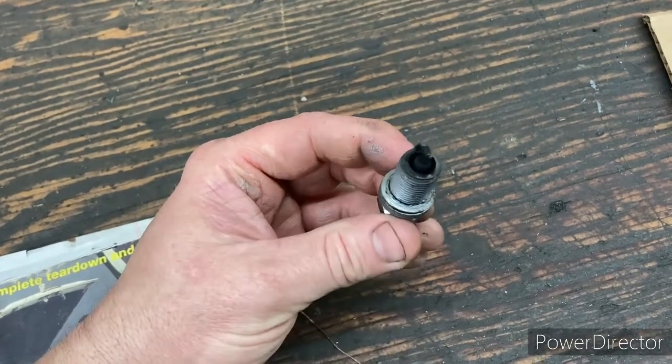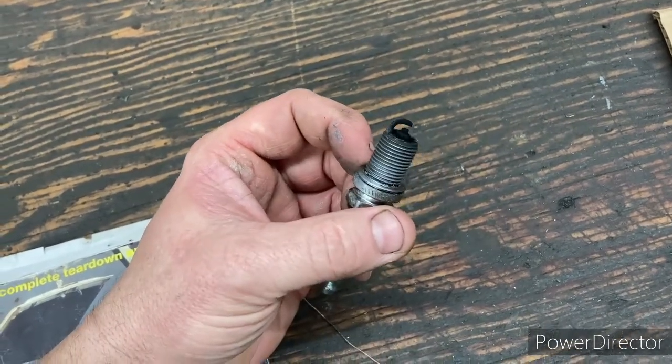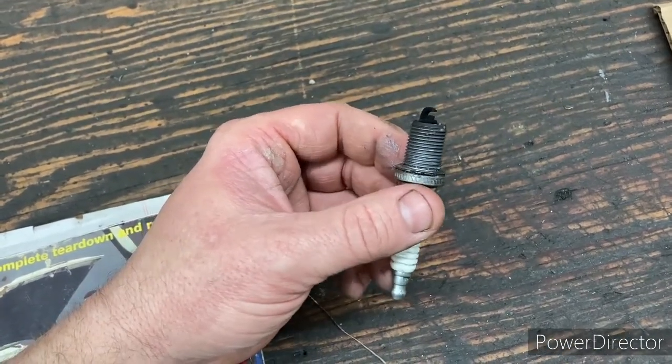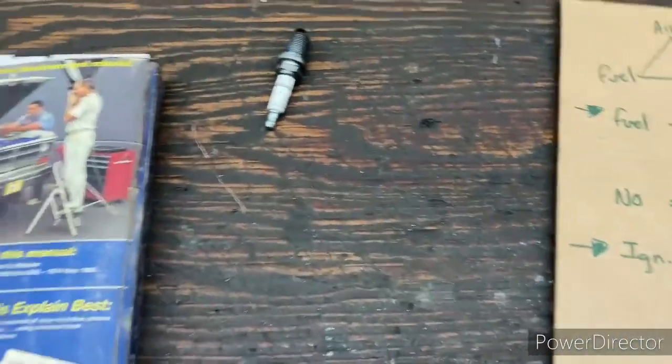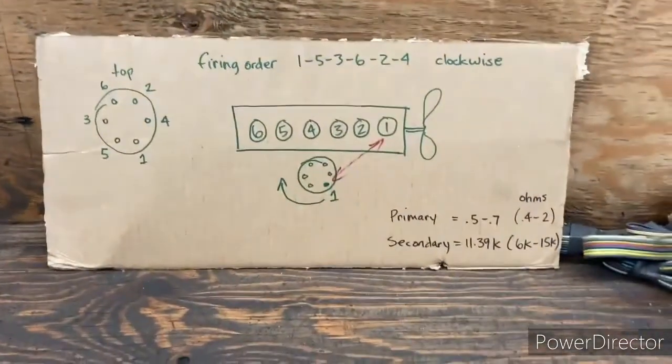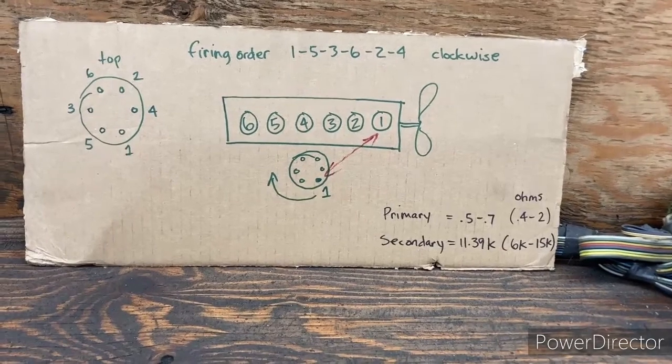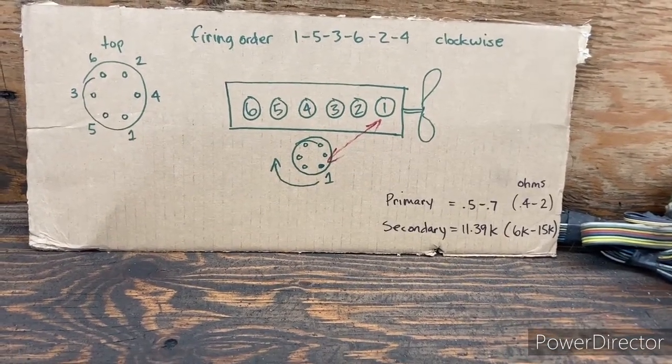And they're all sooted up here, which is basically too much fuel again. And so right away, I just start thinking, okay, we got to prove our spark, right? So when we go back, we prove our spark. Start from the plugs, right? So you want to start from the plugs, check them plugs.